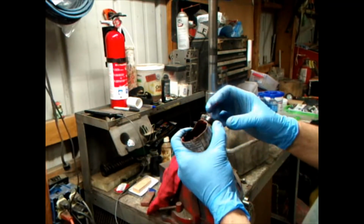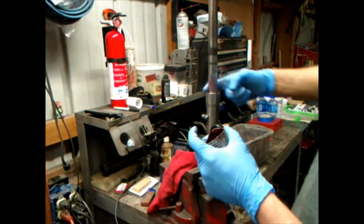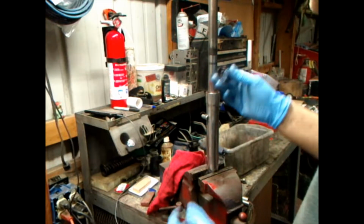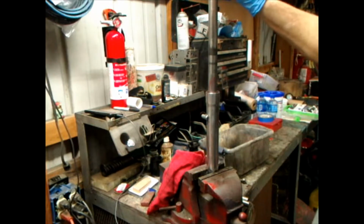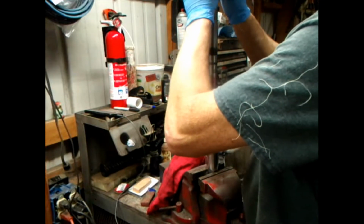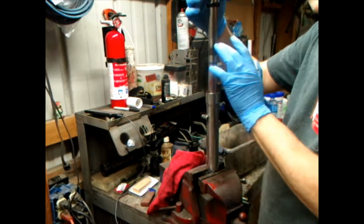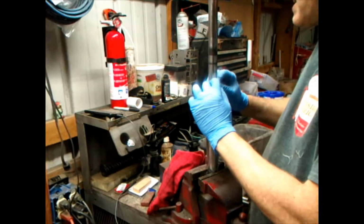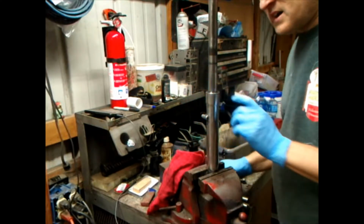So anyway, we're going to put a little grease on the fork. I call it a shaft, but whatever, because I'm used to doing hydraulic cylinders. I kind of lubricate all that up so I can get the seal down in there. Finagle that seal around there, roll it, rock it. Just don't try to do it square. Sometimes they don't agree with going down there square. So, yeah, I already polished up that as much as I could.